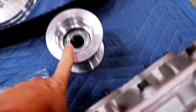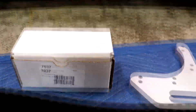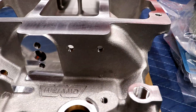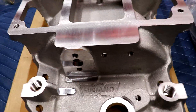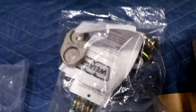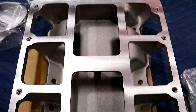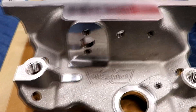It also came with the idler assembly and mounting bracket, locating pilot, and the intake manifold — just machine cast aluminum. The manifold has two ports for vacuum references. This is where the blow-off assembly goes: a couple of springs with this little plate, which acts as a pop-off valve when you end up getting over-boosted in the manifold.